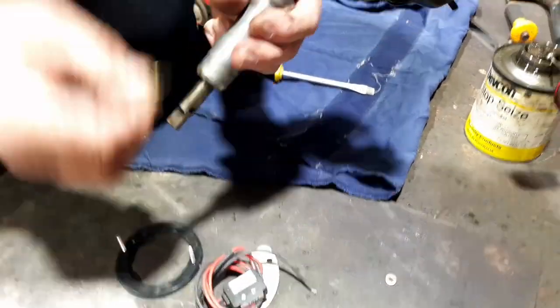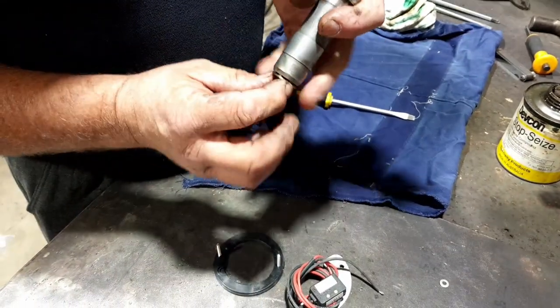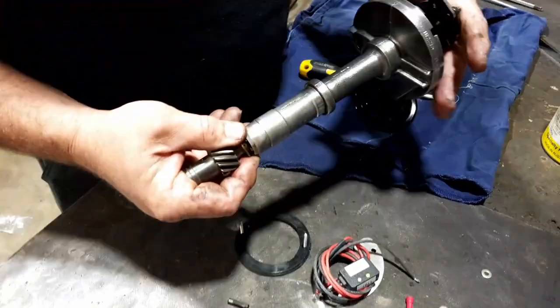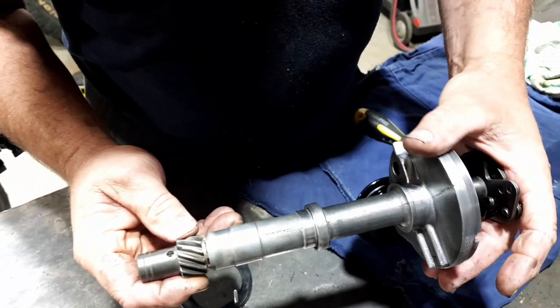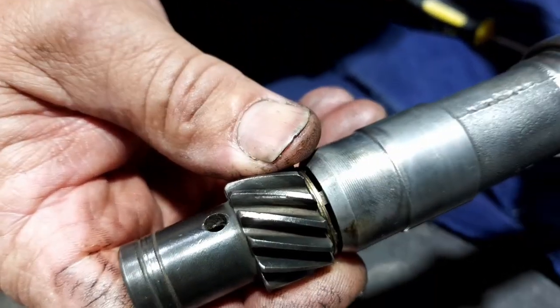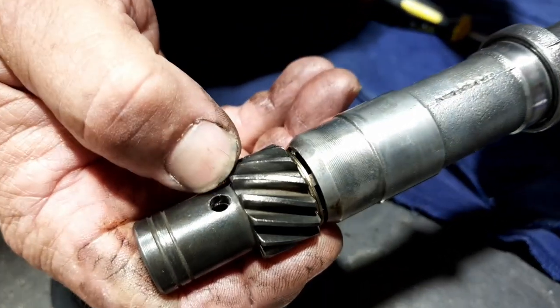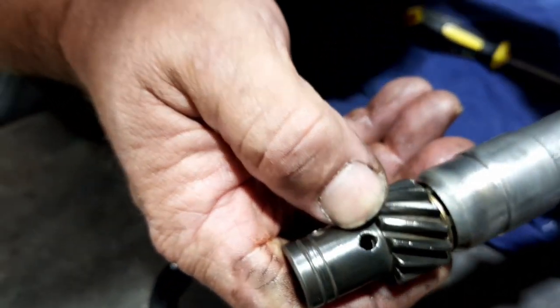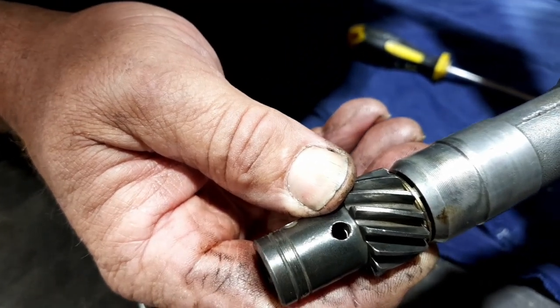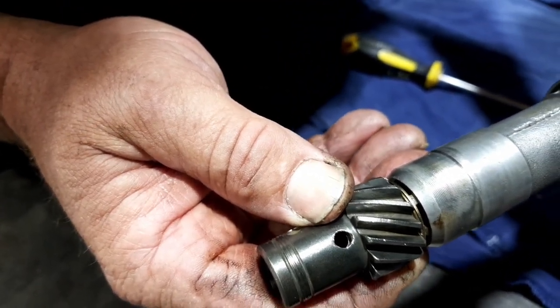So I'll just double check the float on this, how much we've got. What I'm doing here is lining up where the roll pin's going to go, in that little hole you drop down the bottom. You can see that right there. I don't know if you can see it, there. See how it's slightly out? Which is fine, because by the time I bring that back down there...